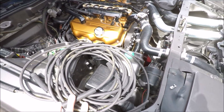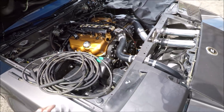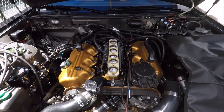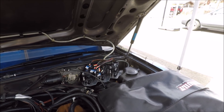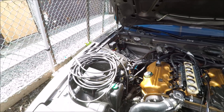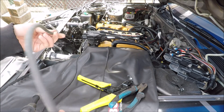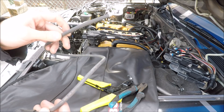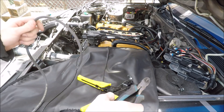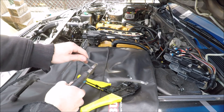Here's the kit I showed in the parts video — it's the JEGS universal LS version. I'm going to show you how to crimp and terminate the plug wires, because they're all different lengths and we'll have to measure and route them to the corner. There are a few specialty tools needed. Pretty much what we're going to do is measure them out, and then we'll just use some side cutters and cut it off — a nice, straight, clean cut.